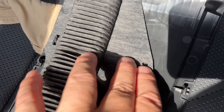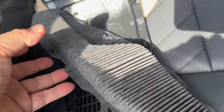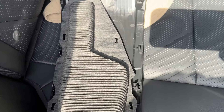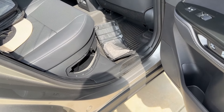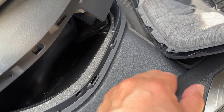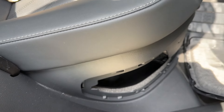So I put it back — this is the orientation. It's very easy to do. Make sure you also check the cover and check both sides of the filter if you're going to reuse it. In my case the vehicle is around 5,000 miles, so it's not really that dirty at all — I'm just going to put it back. Notice the hybrid battery is inside the vehicle, so don't spill any water or use any cleaners in particular.